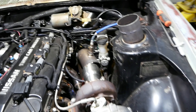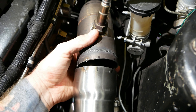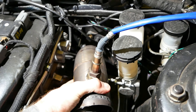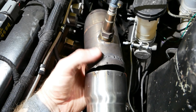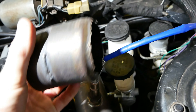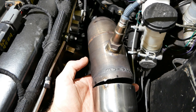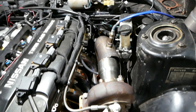It's the next day. Here's where we're at. I've got the downpipe connected to the exhaust underneath the car, and the pipe positioned pretty much where it doesn't hit anything. I think what I need to do is just create a tiny little pie cut right here, just because the piece that came off had a couple of different bends in it. I just need a little bitty pie cut and sliver that in there just like that, get it all tacked up, and then pull everything back apart and weld it up.